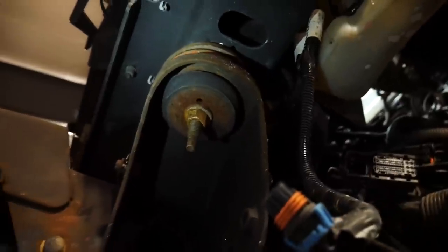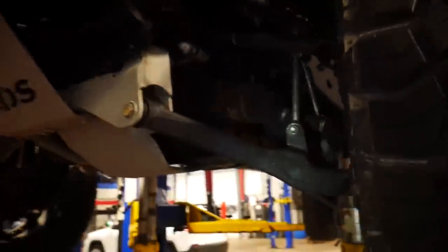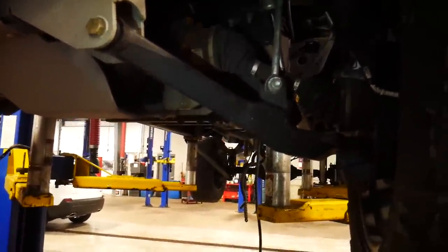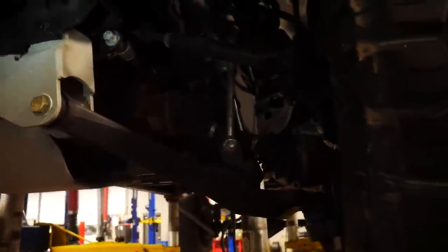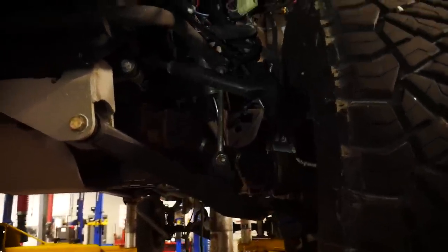All out in one piece. Now we are ready to take out our cab bolts. So we've got one, two around the lift here, three, and then a smaller 18 millimeter one with a bolt and a nut in the front — that is on each side. Go ahead and pull those. I have a lift pump that I also have on the vehicle, so I had to pull the wire down for that one and need to pull that one up through the top. So I'll get that all done and handled and then get these bolts out and then we'll be lifting the cab up off this guys.